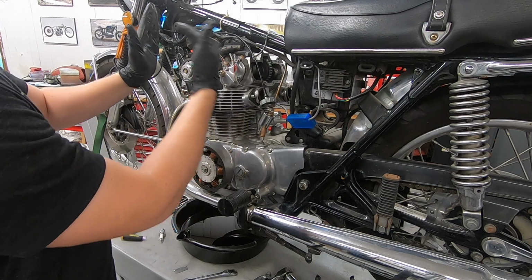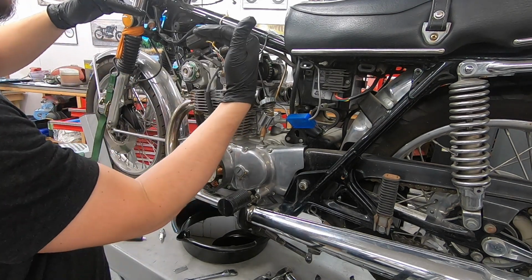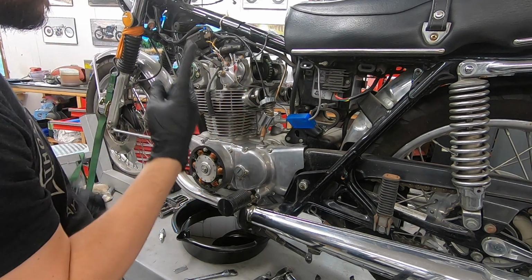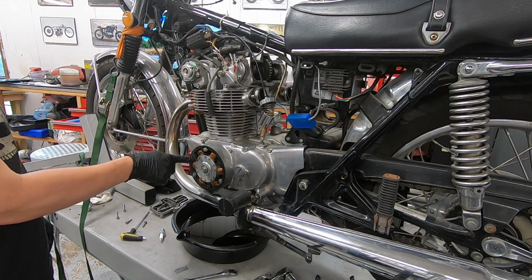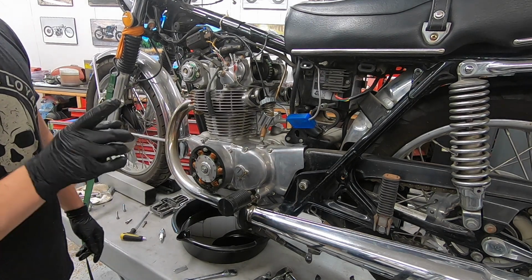If you think about the LT mark being at 9 o'clock on a clock, then you have the T mark at 3 o'clock. You need to make a mark right at 12 o'clock. That 12 o'clock mark, we then need to match up with the little timing arm that's on the crankcase. But we need to make sure that's on the compression stroke.